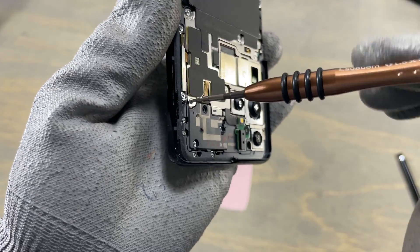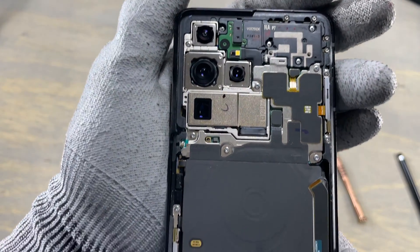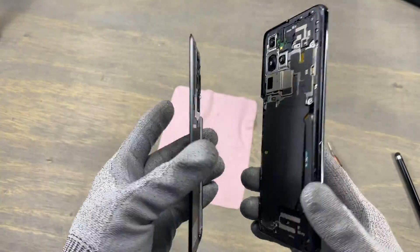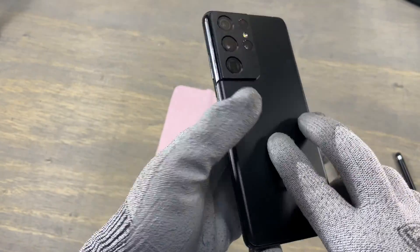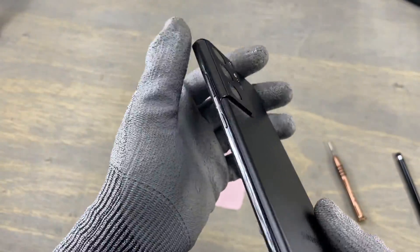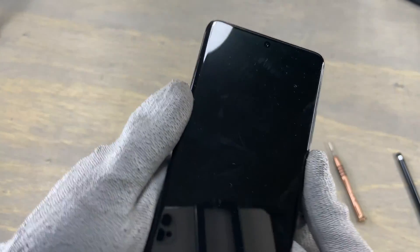Insert back all the remaining screws to their original positions. At the top, we have nine screws on the motherboard and two other screws on the 5G component. At the bottom, you need to insert back four screws. Check again everything to make sure you have inserted all the screws back in. It is time to insert back the back cover. The right way to seal a back cover is to always remove the old glue and add new glue. I will have a video coming for the back cover replacement of this Samsung S21 Ultra, where I put the new glue and clean everything.